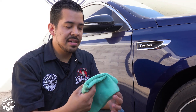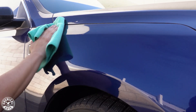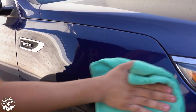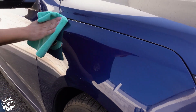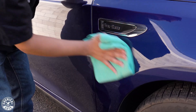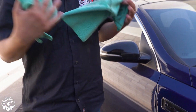Once you've done that, you'll see a little film left behind — that's what your secondary dry microfiber towel is for. Buff off any remaining excess and any grime you may have missed. This also buffs in that layer of sealant which protects the surface from harsh UV rays, gives it a nice deep shine, and reinforces any protective coating already on your paint — whether it's a sealant, wax, or even ceramic coating. In summary: spray, let it pick up loose dirt, wipe with a rolling wrist motion, then buff with the dry towel.